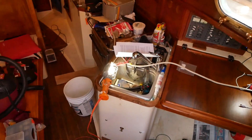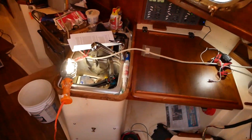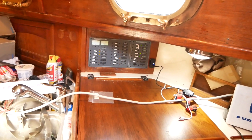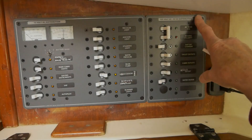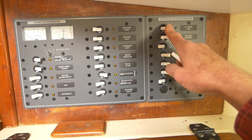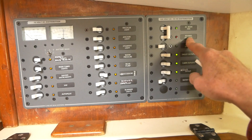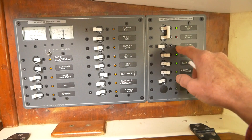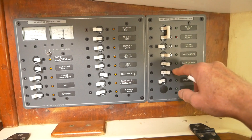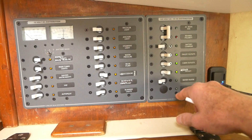In this video, we'll be going over what I had to go through to install a new DC and AC panel at my nav desk over here. This is the AC side — the Blue Sea Systems 8027 with the main power off, including a reverse polarity indicator, and 15-amp breakers. Usually just three come with the panel; I bought two extra for my needs.